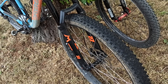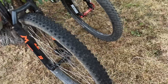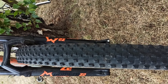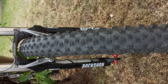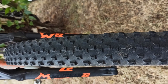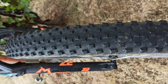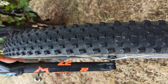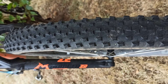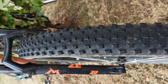On the negative side, you decrease your leaning angle. Looking at the profile, this wide-rim tire is a lot more round, so if your leaning angle is too sharp, you lose grip when cornering. It happened to me maybe two or three times over the last two years, but I don't ride that aggressively anymore.